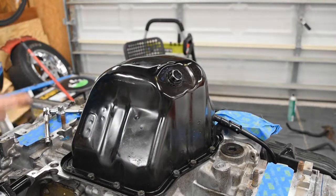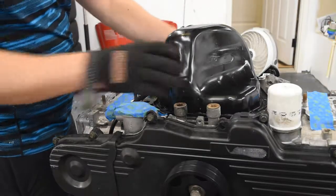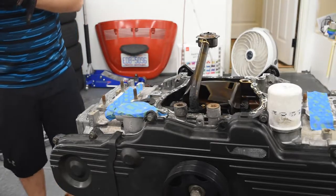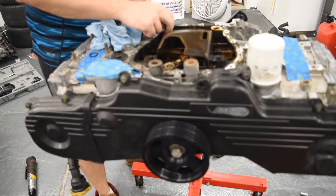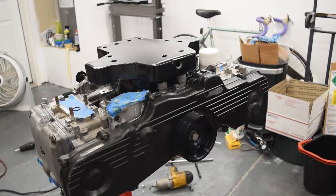Last thing we'll do is remove the oil pan for the shorter unit. And last thing before we put this oil pan on is just get rid of any of this old gasket with the razor blade. Okay, so now we have the shortened sump. It's only held on with a couple bolts. The pickup's not in there. It hasn't been sealed up with any silicone or anything. But we're just putting it together now for mock-up so I can route the coolant lines and the fuel lines